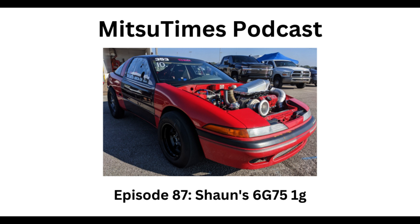I've got two extra long blocks, including MIVEC heads. I'm also building a V6 but I think I'm going to try to stay all-motor. The car only ever went 12.2 all-motor because I couldn't get it to rev past 6,800-7,000 RPM due to the valve issue. I had it in my head it was a Holley issue, but it wasn't until we put the turbo on that the problem really exacerbated. Kevin took a look at a log and said 'you've got valve float.' I took it apart and sure enough. I wish I'd kept it all-motor longer - I really think we could have got a lot more out of it.